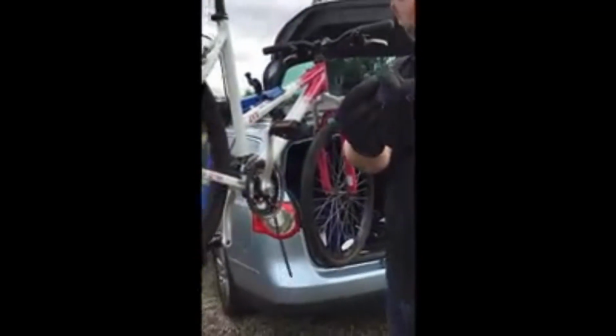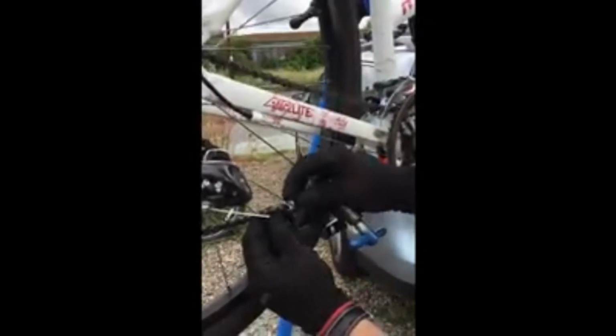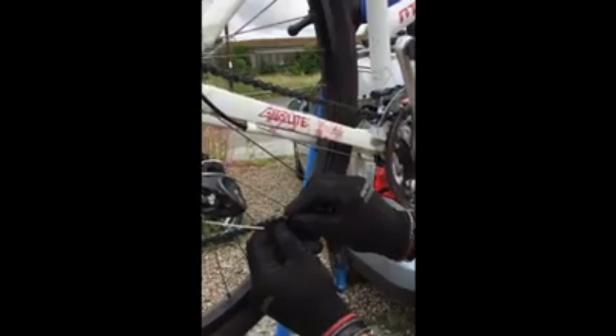So we have to make sure that when we've got this chain to the right length, we allow one link, because we are going to add this link in, and also we're left with two open ends. Otherwise we can't get the speed link to fit. So how do we do that? We keep one end and we line it up. So if you imagine we took that piece of chain out and that would leave us with that open end there, and we're going to actually substitute that piece with our speed link, aren't we? So it'd go there like that.